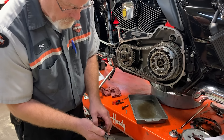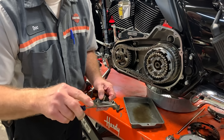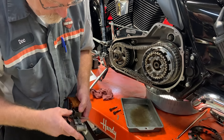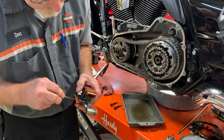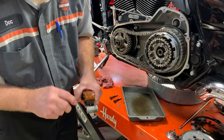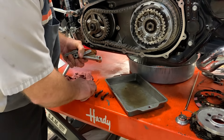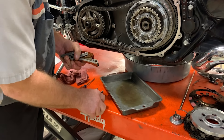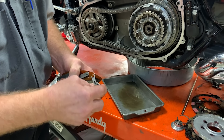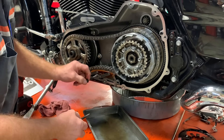There's a little trick for putting this back together. If you have an old-fashioned screwdriver with square edges, put it inside and rotate it to compress the spring. Slide it out, and you'll probably need to use a zip tie to hold it — new units come with one included. It goes back in with two bolts.